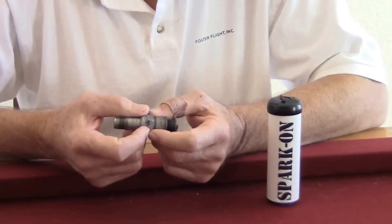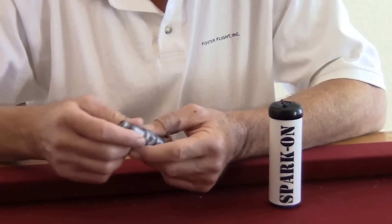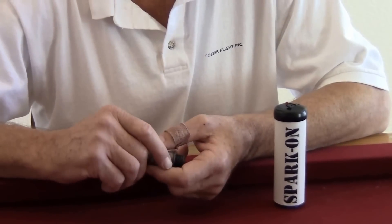If you work on airplanes, you know that these shielded plugs generally have a resistor in them — about a thousand ohms or two — that works in conjunction with the harness and the magnetos to deliver an appropriate spark while minimizing RFI.